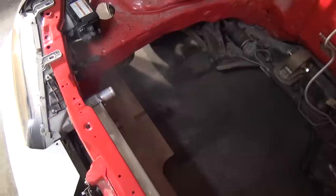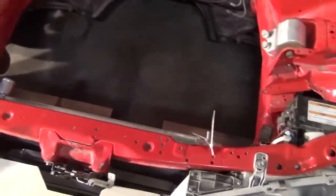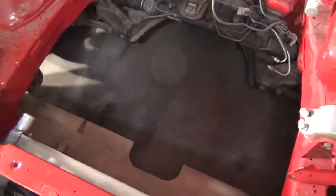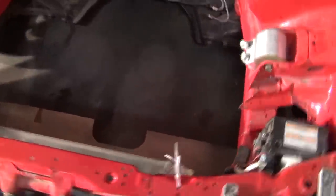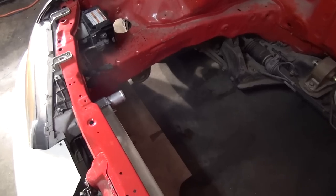So it's a 2.5 inch radiator. It's a dual pass, 2.5 inch thickness for the radiator, and as you can see, only about an inch is actually protruding out. So it kind of gives you that clean look, not a tucked look, but definitely clean. Look really closely down here, you have the intercooler that sits right up against the Mugen front bumper. So I have to probably properly align everything so they don't touch,